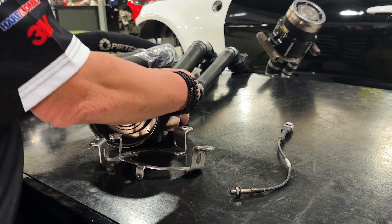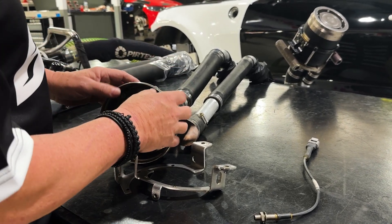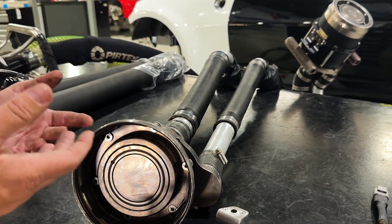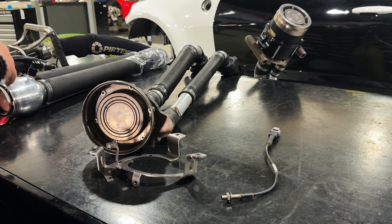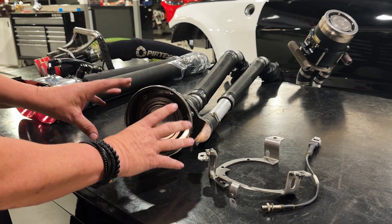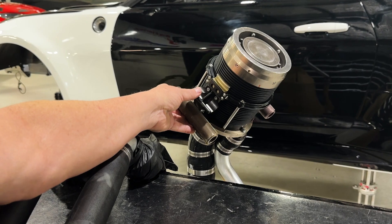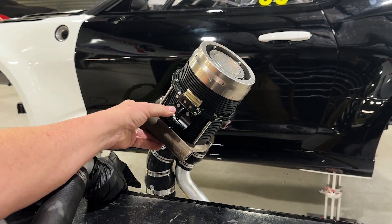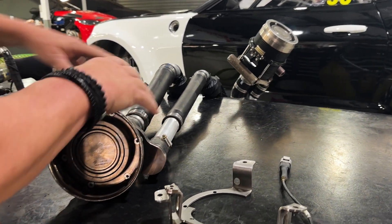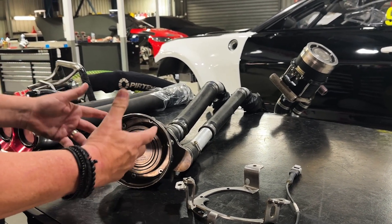This is quite a complex system. All the spring-loaded parts are on the inside here, and the way this system breathes is also on the inside. You can see the different size hoses, and the fuel gets dropped into this slower than it does with the old system. It's quite a bulky system — that's the piece that goes on the car. This is what the head looks like that you put on the fuel tower to plug in, and you can see it has little catches there. When you finally get that thing guided in, you let go of those, it engages, and the fuel starts to run through it. It's heavier and bulkier, and a little trickier to use.